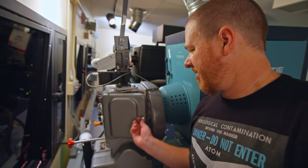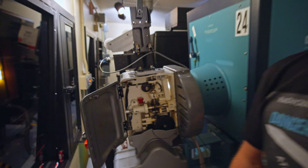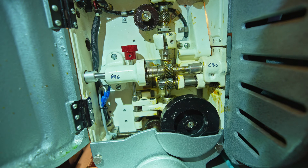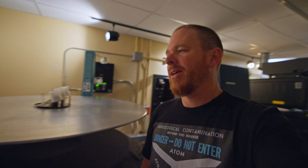The other thing I was trying to do is chase down this shutter problem, so I had to look in the back of the projector. Inside there are a couple of fiber gears. In case the projector gets seized up with film, it won't completely destroy everything inside — it'll just strip out that fiber gear, which is a lot easier to replace than replacing the whole drive shaft. I found a screw that was backed out a little bit, so I screwed it all the way in, and hopefully that fixes my flicker problem.